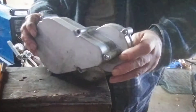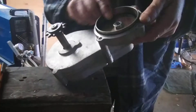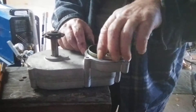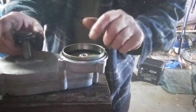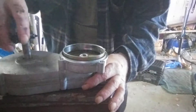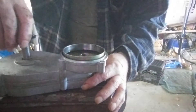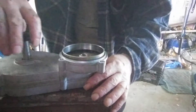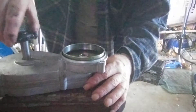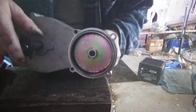So this is the transmission — it transmits to the chain through here and the clutch packs. This is the housing, the bell housing for the clutch. Here's the problem: watch the top edge of this — you see it wobbling? If you watch this edge over here, you can see it going up and down. It's quiet but it's also wobbling.